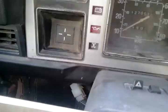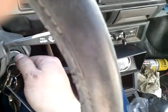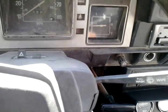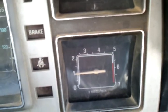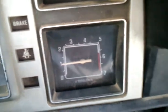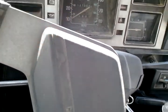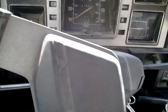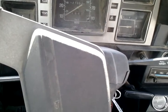Here is the startup and listen of the engine running — starts right up, no problem. Idling just a teeny bit high, but the manual says four-wheel drive should be 800 RPM plus or minus 100 RPM, so not that far off. I think I just have a little too much tension in my throttle cable. Headers and Flowmaster exhaust.